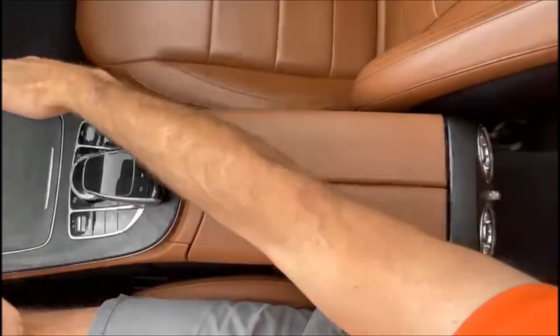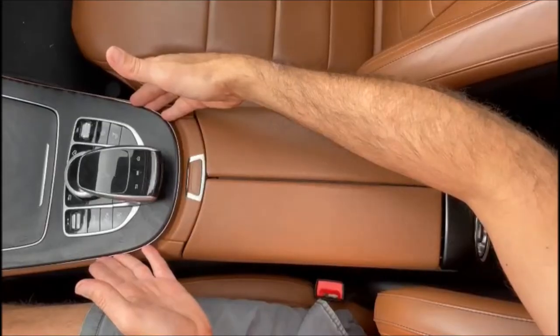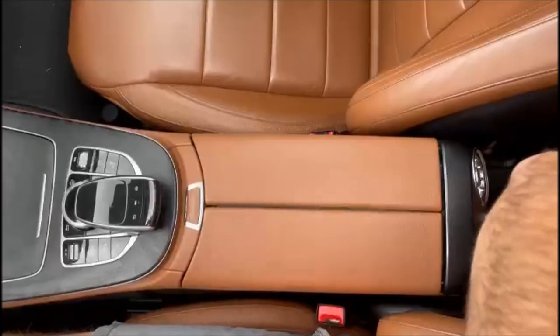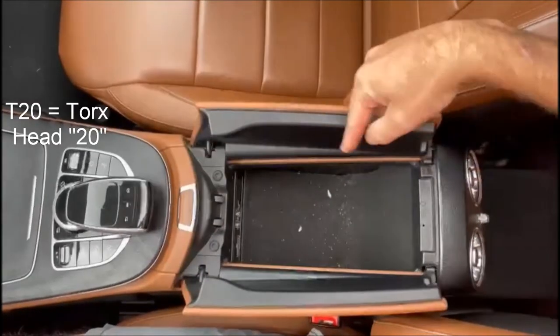The second-hand part is a little bit scratched on the back, but later in the video we'll replace that with the good part from the controller in the car. So without further ado, let's start off with removing the centre console. To do that, all you have to do is remove four screws — they're all T20. Open up the console and you'll see two rubber bungs.